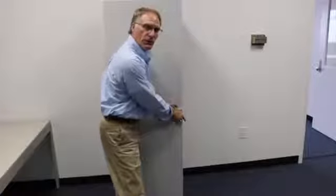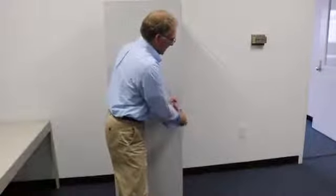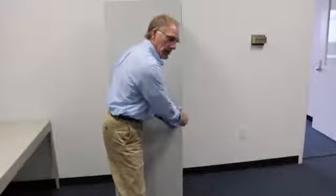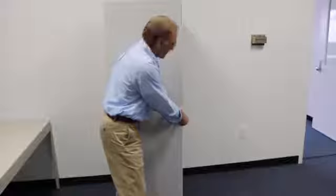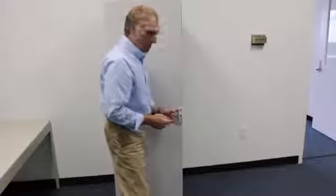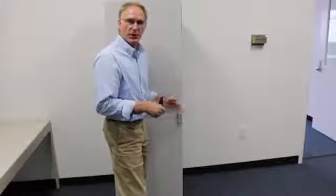The original lock and unlock for the TS-8 is: counterclockwise would unlock, clockwise would lock. Since I've reversed my door, it's also changed that motion to the opposite. If you want to change that back to the original, then we have to take this off and raise the pin position to the upper pin position. To understand what I'm talking about and to see how this is done, look at my video for changing out the standard lock with the comfort handle.